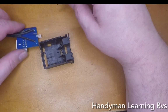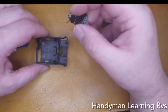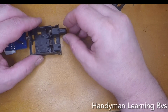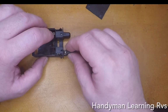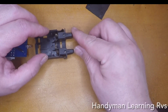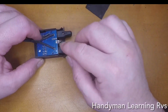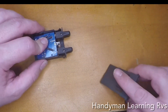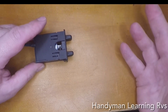Now to put this together, you know that the wiper washer is on the opposite side of this, so look for which says washer. So the washer will go to here. Slide the washer in. Make sure you get it where it pushes. These bend, just bend them back straight, similar to what they were when I took them out. Now with those on, those sticking right there, take the switch, slide it down, and boom, inside. Now it is against what it rides on. Now holding it down like this, I'm going to line up the switch and slide it back together.